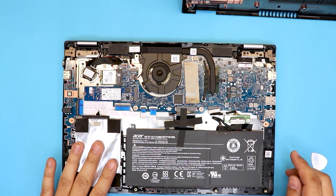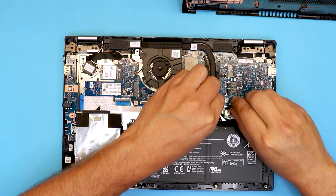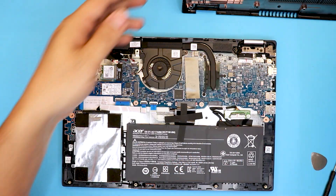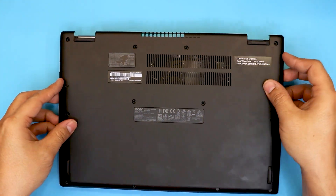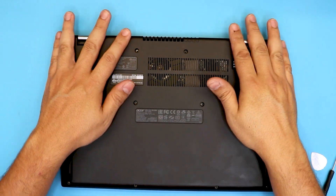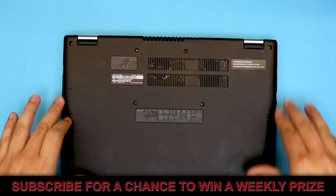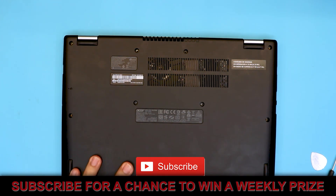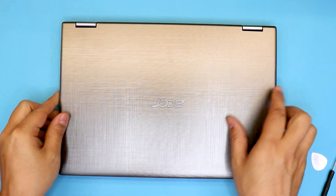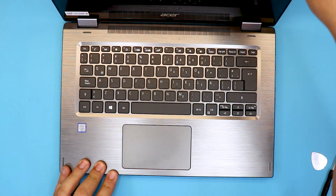That's how you upgrade your hard drive. To plug the battery back in, just slide it right underneath and push it towards the connector. Then grab the bottom cover, stick it right in there, and push it down on all the sides. Put all the screws back at the bottom — they are the same size so don't worry about it. I hope you guys liked this video; if so, click that thumbs up and subscribe — it really helps. Leave any comments below and I'll see you guys in my next video, thanks for watching.